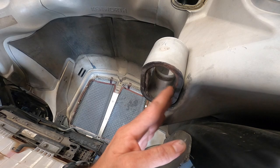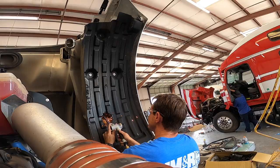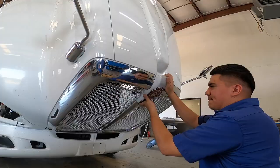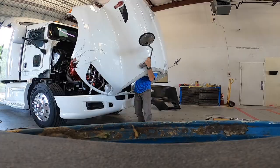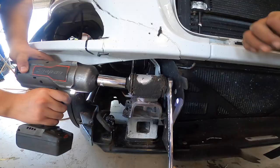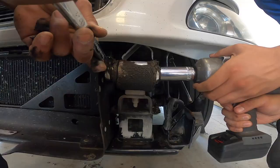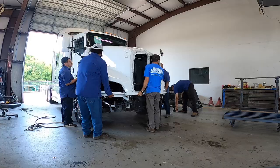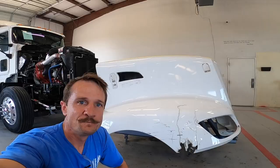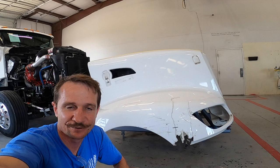And that's it — we're going to yank this hood off there and get rolling. As you can see behind me, we've got this hood off the truck. It's completely disassembled and I'm ready to start burning in it and getting the fender off. To do that, I want to heat the seams up to just shy of about 300 degrees Fahrenheit. That's going to allow the glue to release and the fender will just pop right off.